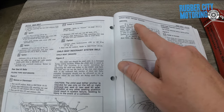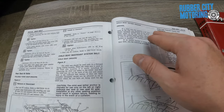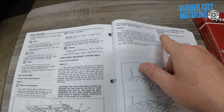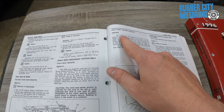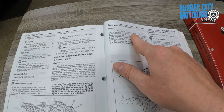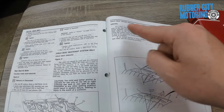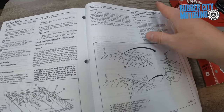It says if the child seat requires a top strap — that's basically the strap that goes from the back of the car seat — and it goes to a third anchor point, like on our new Kia where those anchors are on the back of the rear seat and you string it up, over, and attach it. So if a child seat requires a top strap in the rear seat position of the sedan, a special dealer-installed anchor must be used to anchor the child tether to the rear window panel, at the correct tether angle. If the anchor bracket is being installed for the first time, use the following procedure.